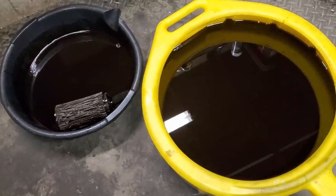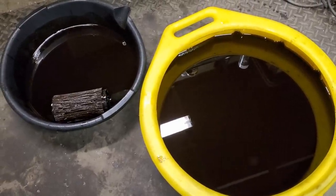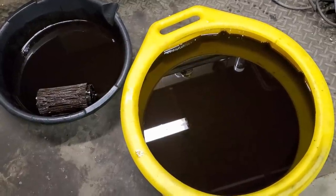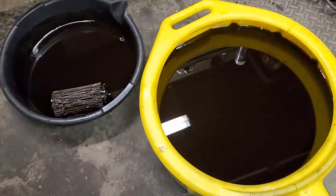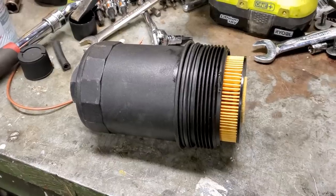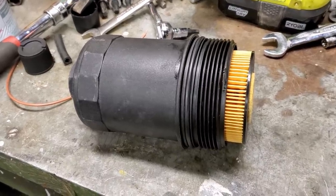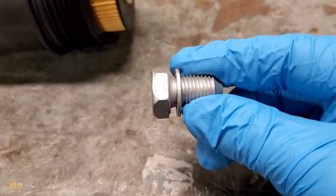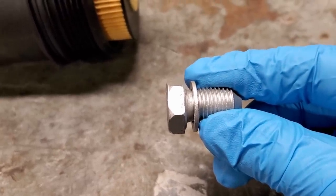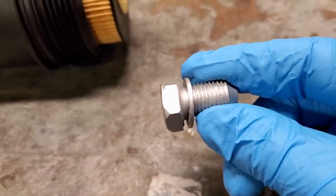Here's the old filter and the old oil that I took out. It doesn't look too terrible - I don't see any kind of contaminants or anything in it, no metal shavings. It just looks dirty. No telling the last time it's been changed, but it'll have a fresh oil change in it now. This thing has a canister style oil filter, and here's the brand new element inside the housing. It's always a good idea to change the crush washer when you change the oil. On this particular car, the washer is actually made onto the bolt, so here's a brand new bolt with a brand new washer on it.